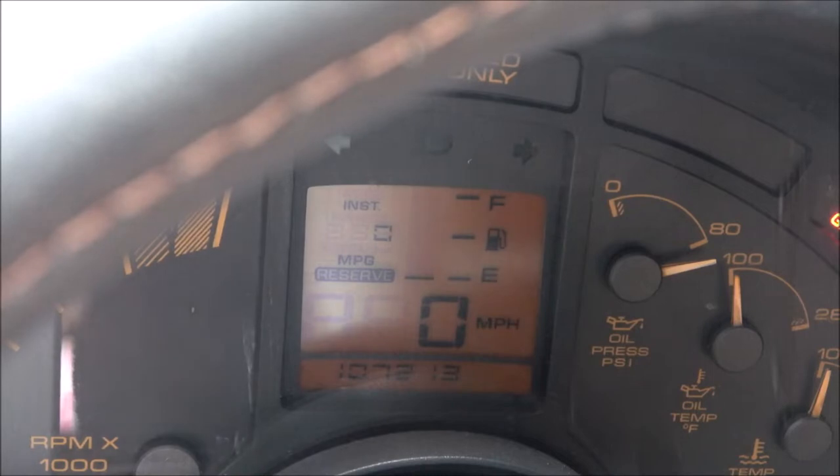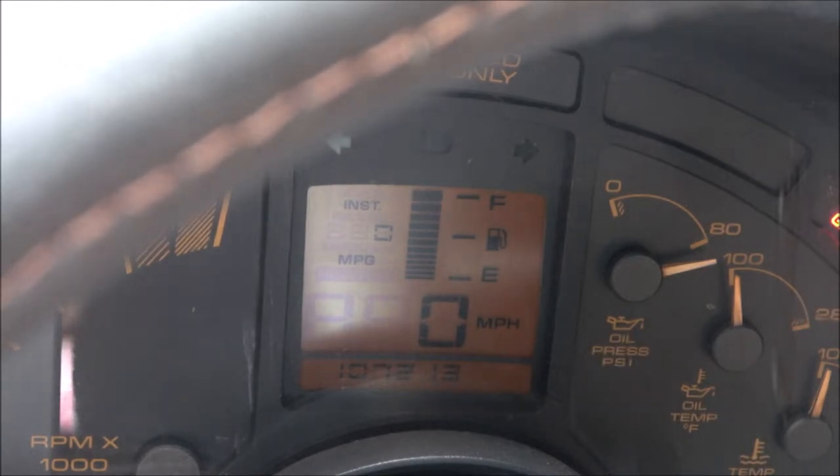So let me get a battery and let's go ahead and drop this in here, get the fuel pump in, and then we'll button this up. Okay, I'm checking the gauge now — I'm going to lift and lower that float so you can watch the gauge. See how it went down? Now I'm raising it back up — and there it goes up. They make them lazy like that, they make them slow, so that if you're going around a turn your fuel gauge isn't jumping up and down. That's why they do that.